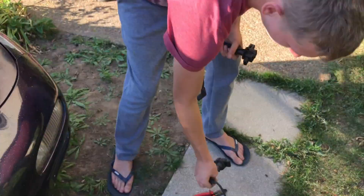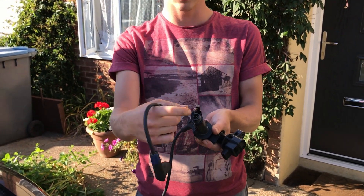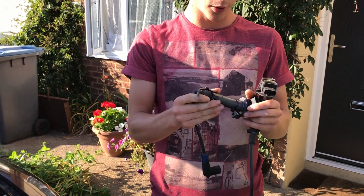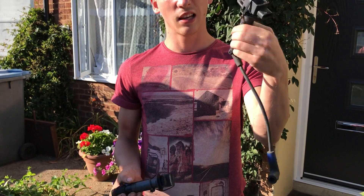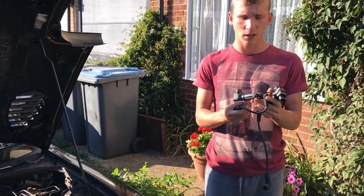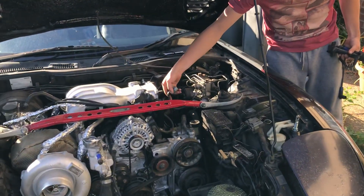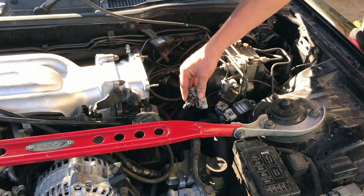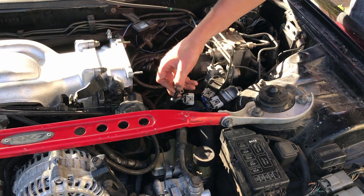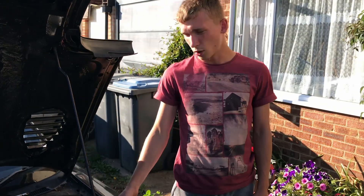What I did was I just removed the rubber boot, exposed the spring resistor, stuck it on, and put a whole load of cable ties and tape. It actually worked, but I kept having problems with flooding because these weren't powerful enough. You can see here it's pretty bodge, and I think one of my wires failed, which is why it started flooding really bad. But I knew this was going to be temporary anyway.